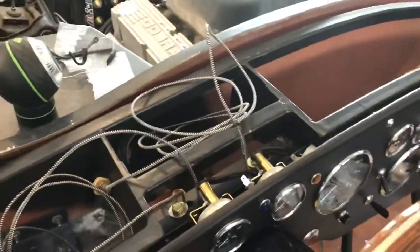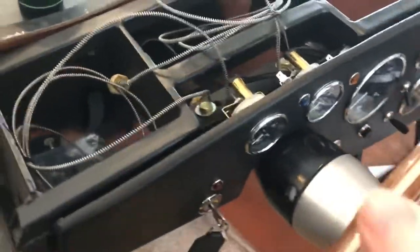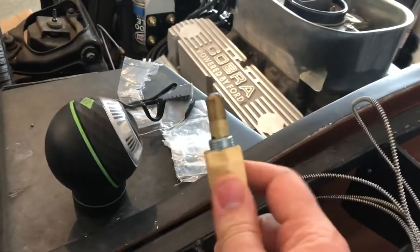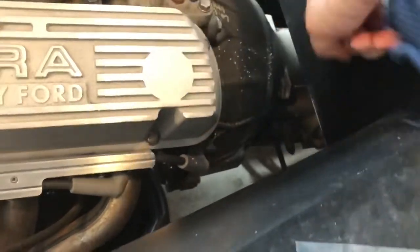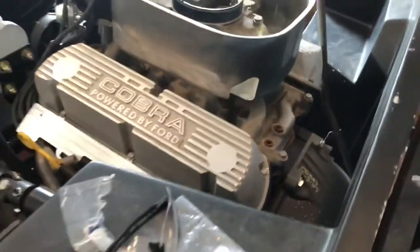What I'm doing today is working on the oil temperature gauge and the water temperature gauge, which are mechanical gauges that include this heavy wire — really a pain. I've drilled an inch and 3/8 hole here; that's going to be a good spot, it won't interfere with the gas pedal linkage above it. I can run the oil temperature probe right down to the oil pan and the water temperature probe up to the intake manifold.